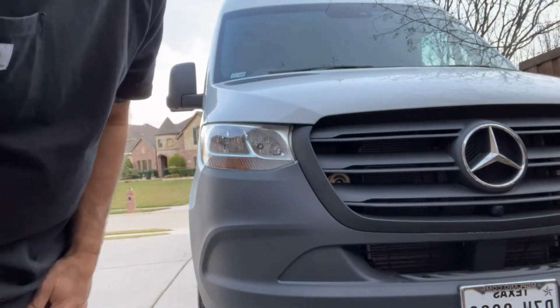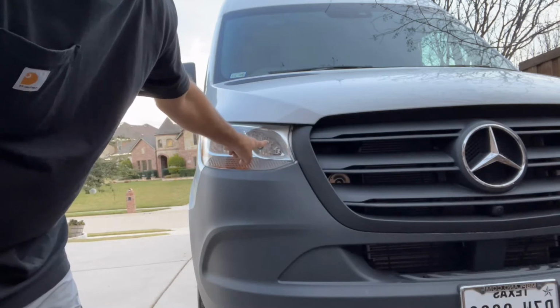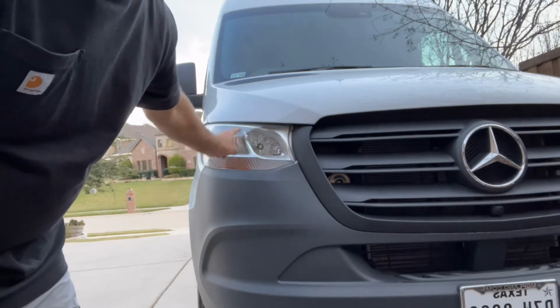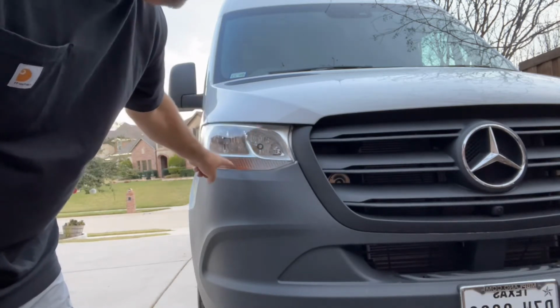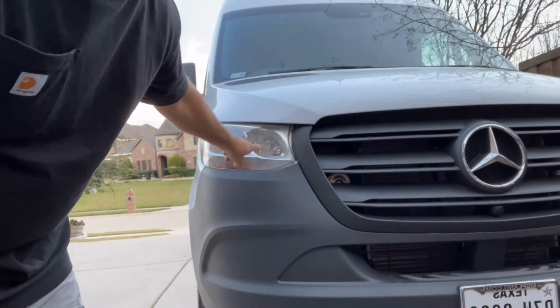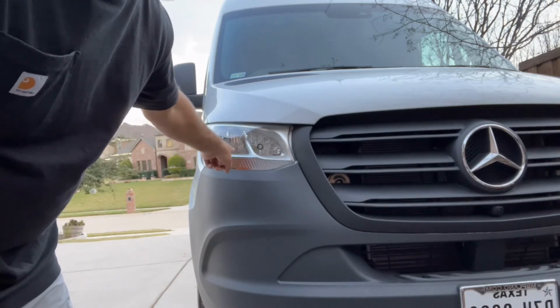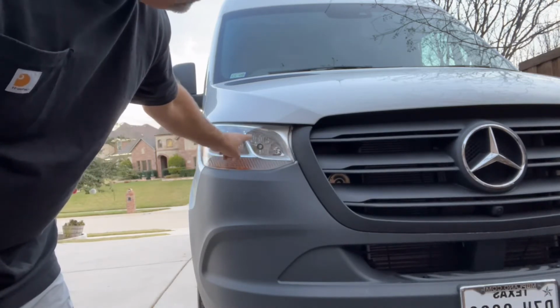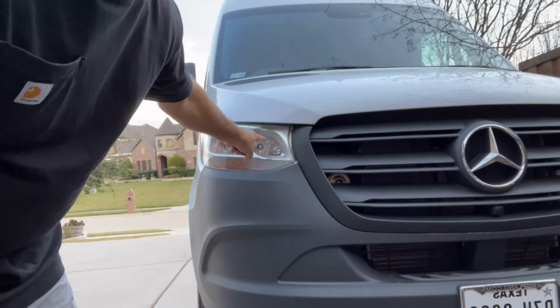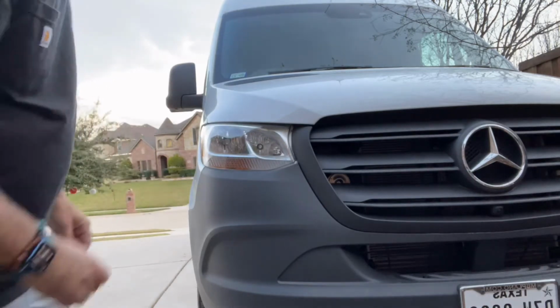Okay, I just put Headlight Experts daytime running lights high beams here. I have, and it's an H15 bulb, and they flicker and then go off, the daytime running lights. These work fine, the low beams, that's an H7 bulb. So something's going on here. Now I'm going to start the car and I think you'll see it happen. I'll go through the cycle.